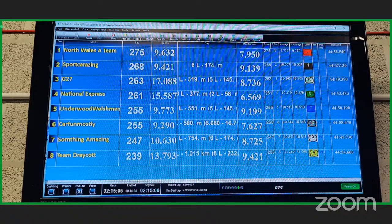And what happened to us was, first of all, we noticed the front axle getting wider. We could see front wheels poking out from the body shell as the car was doing laps. And I brought the driver to the pits. I replaced myself as a marshal, brought the car to the pits and pushed it back together, and realized there wasn't a lot of friction until the wheels were just about to bind as they met the chassis.